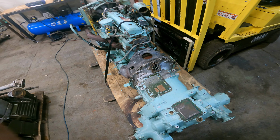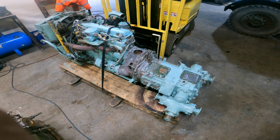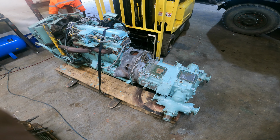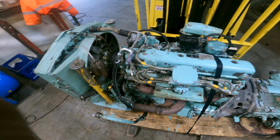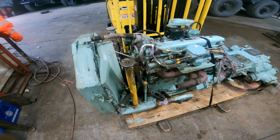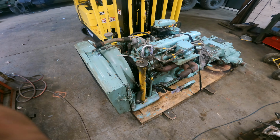So we'll pull the gearbox off and rebuild the fluid flywheel. We would anyway, if you get one of these power units out of a Ferret or Saladin and Saracen, that sort of thing, it's best to do the fluid flywheel seal while it's out. There were a couple of jobs to do to the engine, just paint it really. There were no leaks, nothing untoward that way. Chuck a new set of belts on, replace all the radiator hoses, and chase the charging issue with the generator.